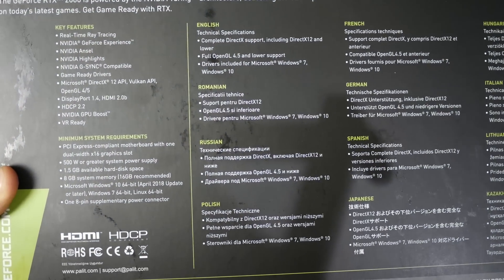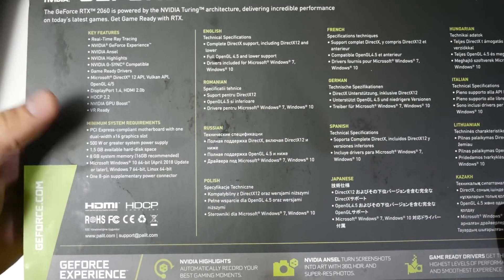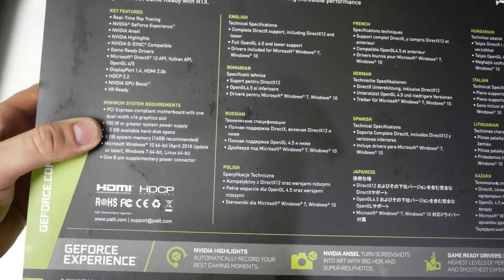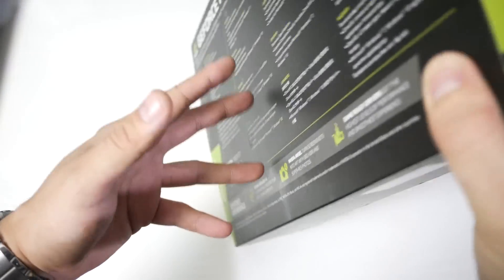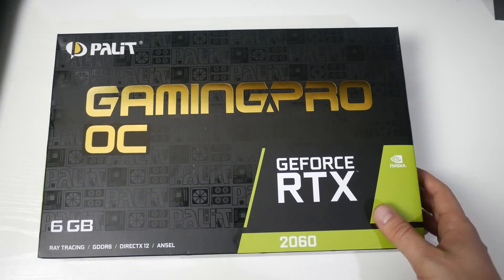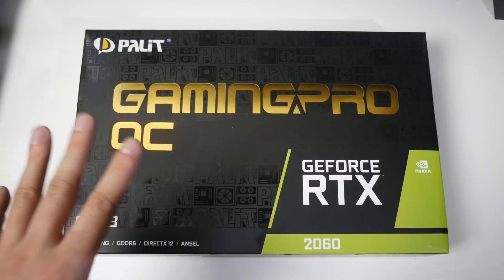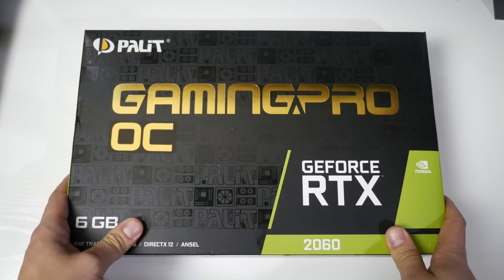There's the back of the box with a few things about the specs. You're going to need about a 500 watt power supply, though I reckon you could probably get away with around 430. This is rated at about 190 watts TDP, and will draw up to about 225 watts when overclocked. I'll be testing lots of benchmarks over the coming weeks and I'll make sure I put all that footage in the description as well.